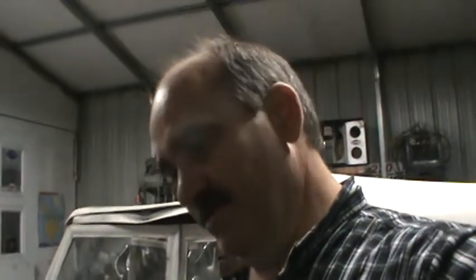When we race these things, we'll either go to a roller cam or we'll put in a tool steel billet cam and then get tool steel lifters. They're called Uno Bakers, and the lifters are about $500-700. But if you don't wipe the cam out, you don't have all that metal going through your really high dollar engine parts. And if you're doing a racing application, I would probably go with the Uno Baker tool steel lifter. A couple different companies sell them, but they're the best known. And make sure they're new when you order them.